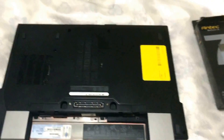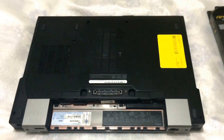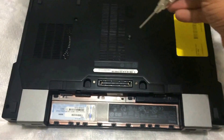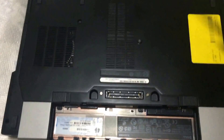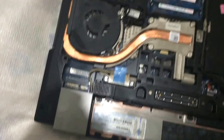Today I'm going to be showing you guys how to fix the overheating problem on an older Dell Latitude E6410 — should be the same on all the 6400 series and possibly the 6500 series. First thing you want to do is unscrew this screw in the middle, which I already did to save time. Take off that plate.